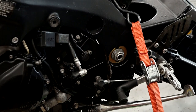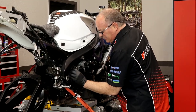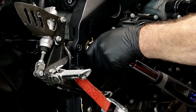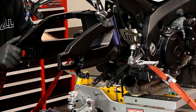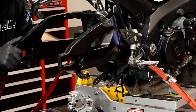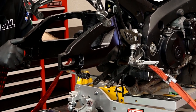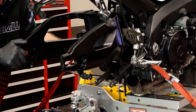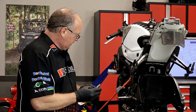There we go. We take the pivot thrust nut with that special tool we had earlier, and we're going to take this to 65 foot-pounds. Alright, we still have a fair amount to put together, but let's feel it now. That's what we were looking for — she's got just a little bit of play. Remember how it was moving almost a quarter of an inch? I doubt it's moving a sixteenth now. Just a thin layer of grease now that we've got this cleaned up.